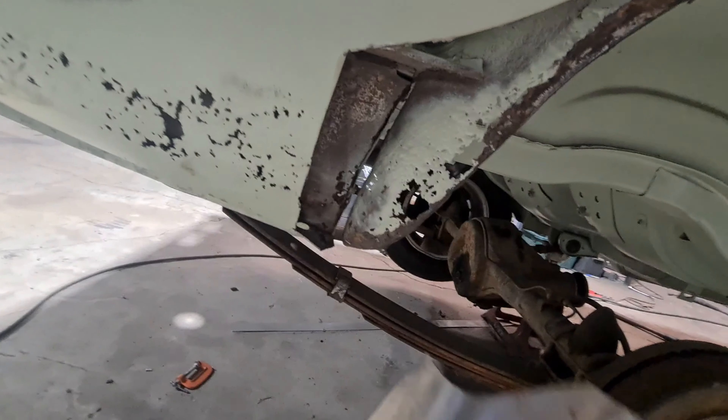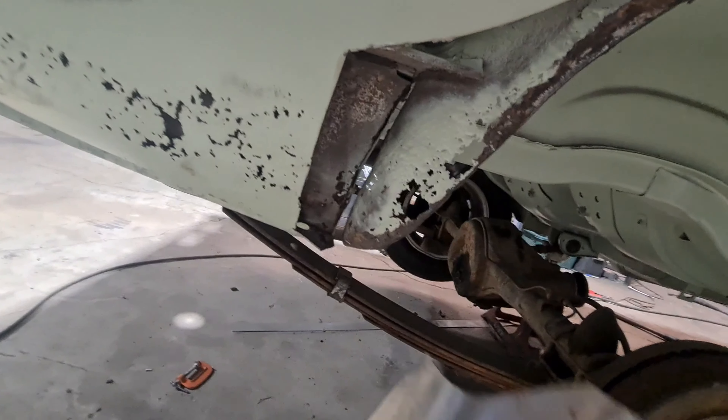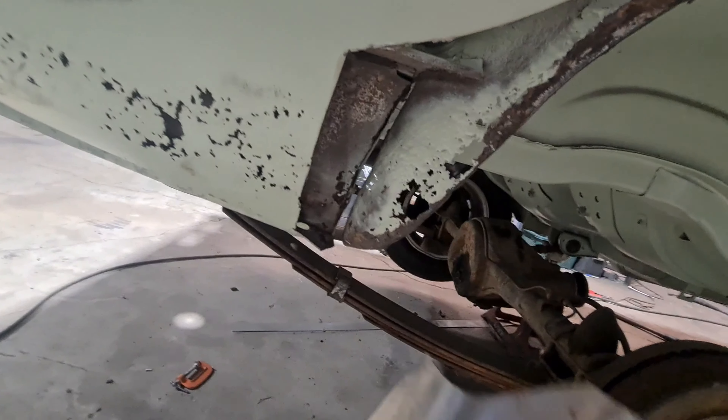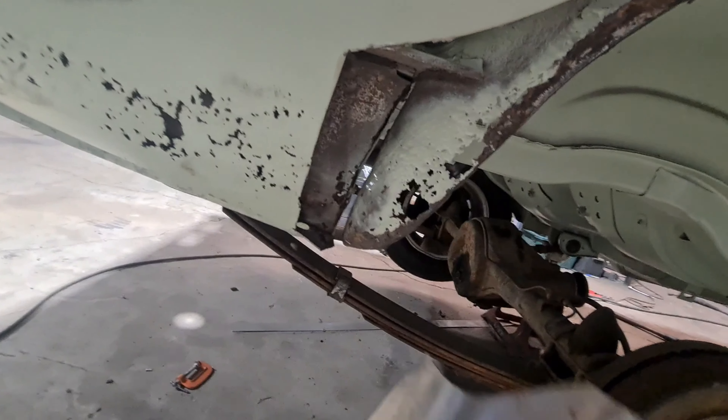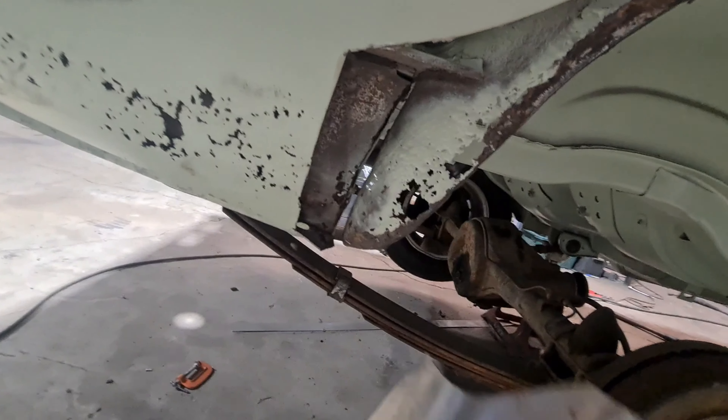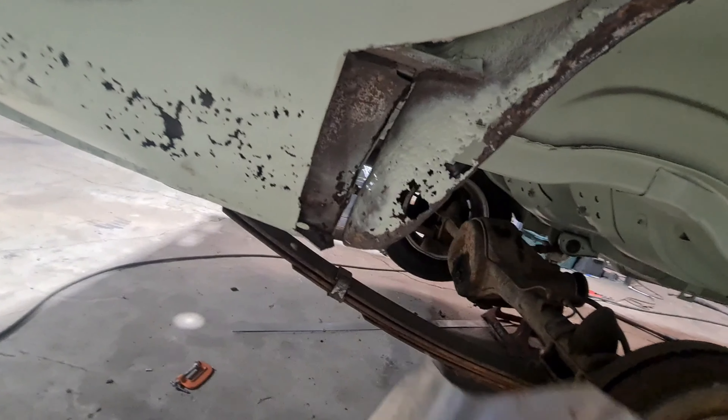There's a bit of playing with the edge up here to pull it out a smidge, but otherwise fitting pretty decently. I'll copy how this fold is for the other side because the other side is massive whereas this one lines up nice and flush. I hung the door and guard on for the first time and overall fitment is pretty bad — it needs to be played with everywhere. The bottom of the guard is bunched up here — it's been stretched — so I have to shrink the bottom lip, pull the guard back to straight. All the body lines are lining up though, so I think that's just how they are. I'll confirm on a few other cars. Aftermarket panels versus factory — you can see the gaps going big-skinny-big-skinny all over the shop. They definitely weren't the greatest fitting, the old Mazdas.